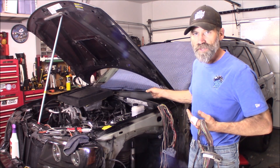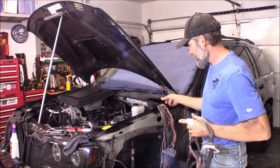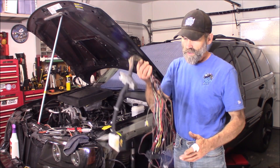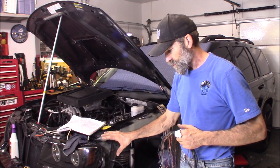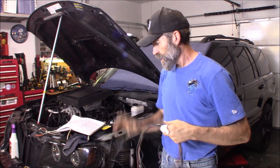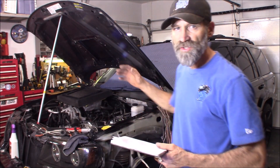I need to drill a hole here in the cowl, pull the wiring back in through there and up. I haven't quite figured out where I'm going to put the splice yet — it's either going to be right up inside the cowl or in here. I got this harness at the pick-apart for $22 and change — not bad for a whole wiring harness. I cut off more than the chunk I need and made notes. You want to write down all the colors of the wires you have here, then verify those colors are the exact same on the harness you got — that way it's a whole lot easier when you go to hook everything up.